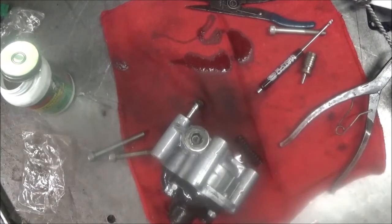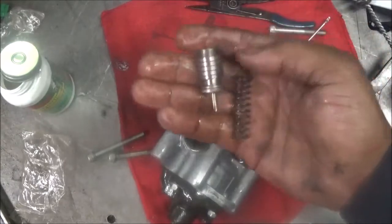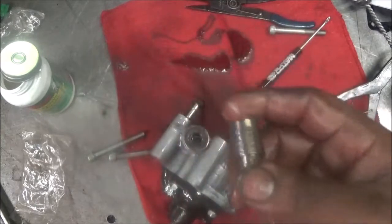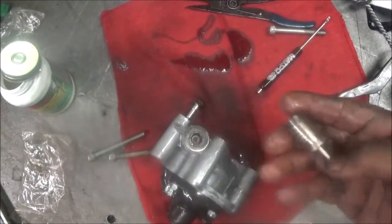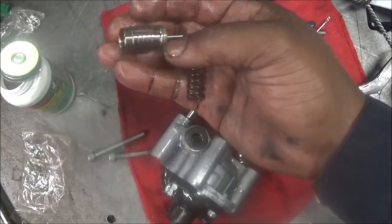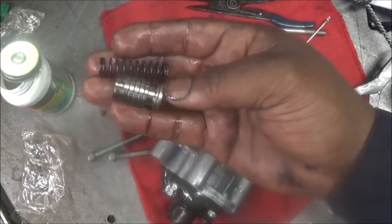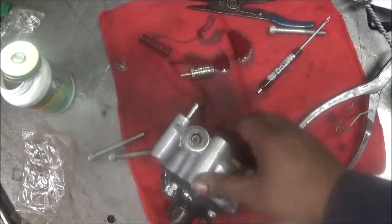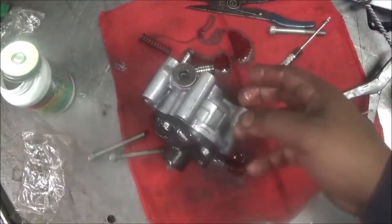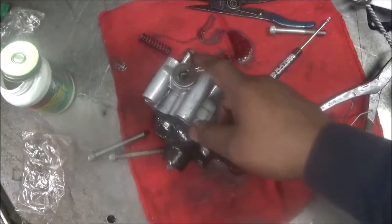The only thing left for me to do is try this and see if there's going to be some pump buzz — but this definitely was no good. It definitely would have caused an issue. What happened is those little balls, when they get in there and break, all the little fine pieces get in there and start making metal, causing these valves to stick. Definitely would have been a problem. Always check that valve and that pump. The next step is to check the valve body — I'll let you know.